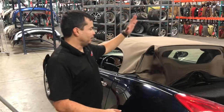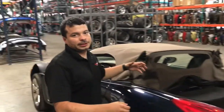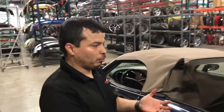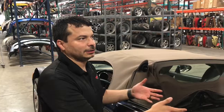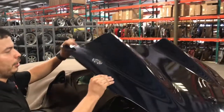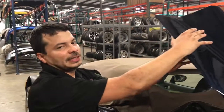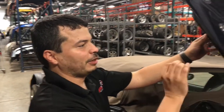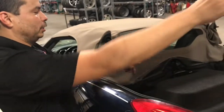And there you have it. We have our buttresses released. Our trunk is now open. Of course, if you didn't have an electrical problem that was causing any of this to work, then you might have some fixing to do. If you have the buttress cables, one of them is stuck, let's say, the fix for that would be inside here. There's a lot of write-ups on the forums that are very specific and very detailed on how to accomplish that fix, and of course how to get your trunk latch working again. But now you have access to it at least, so definitely thank you for watching.